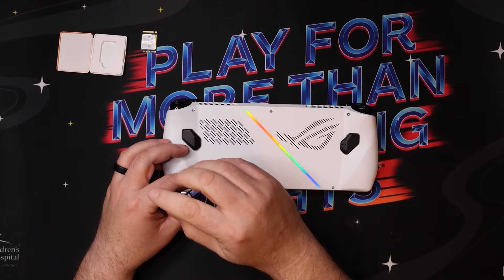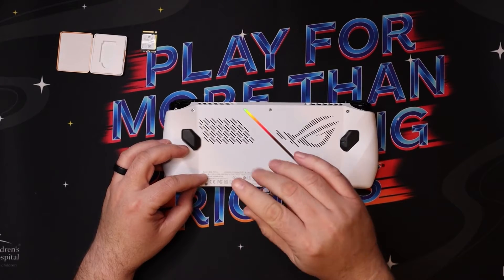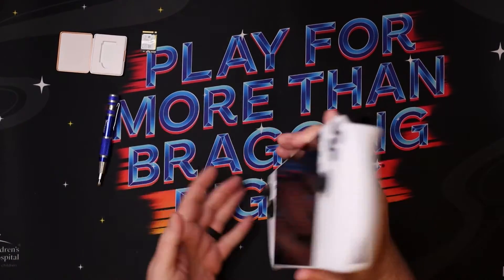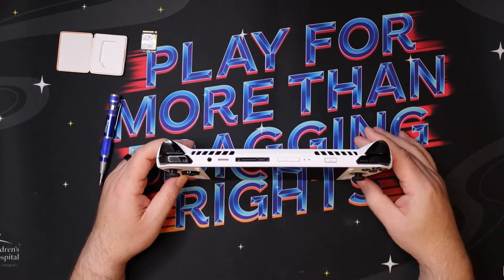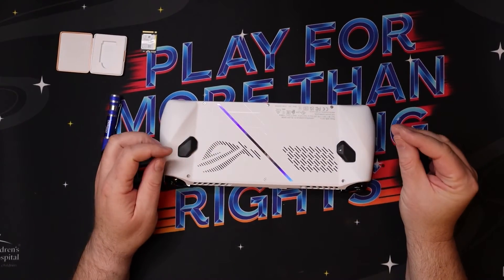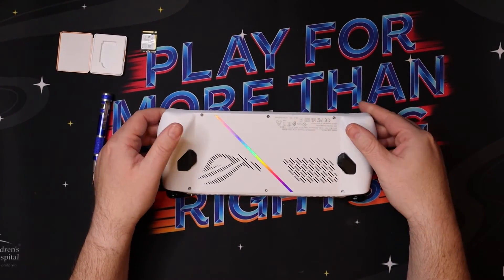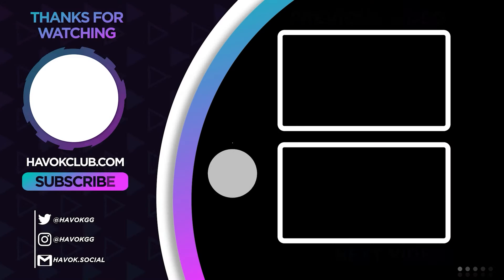As you probably know from having a Switch, micro SD is the easiest way to upgrade storage, but we're going internal here. Put the little master screw back, tighten it down — you want to hear the click — and we just upgraded the storage on the ROG Ally. One thing to note: if you do this and it doesn't power on, make sure all screws are tightened. I noticed during a test that I had to make the master screw much tighter and make sure it clicked before powering on. There may be some sort of trigger system inside that won't power on unless a connection is made by that screw.